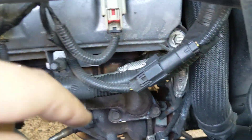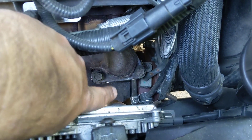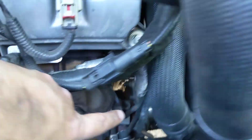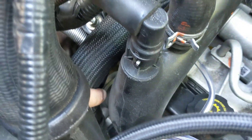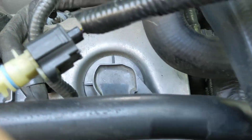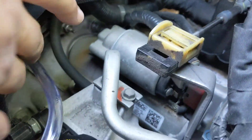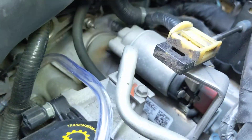One of the diagnostic things we were looking at is on the turbocharger right here. Down here there's your exhaust turbine, there's the center cartridge, and then the compressor side is the aluminum piece way down in there. It has what's called a wastegate actuator on it — they are internally wastegated — and if we get way down here where you can see, there is a metal arm that moves.